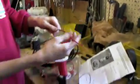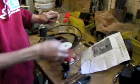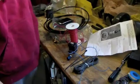It's going to run from our power to the fuse. From our fuse, we're going to go to our switch. From the switch, you're going to go to one of the wires in your solenoid, and the other one's going to go to the ground. Then it's all hooked up. So I'll show you what that looks like as soon as I'm done.